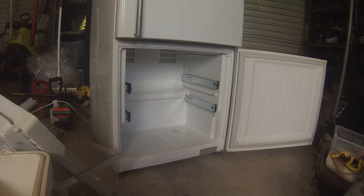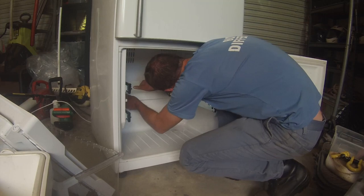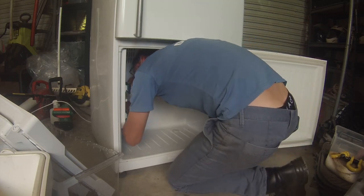This fridge has now been running for three days and suddenly tripped the circuit breaker for this circuit in the house. This is exactly the same symptom I've had on another fridge before when the defrost element was fried. So I'm going to find the element, measure it up, and order a replacement.